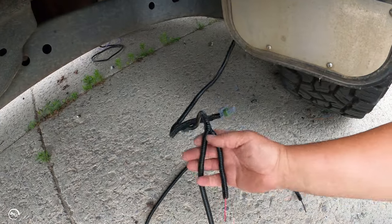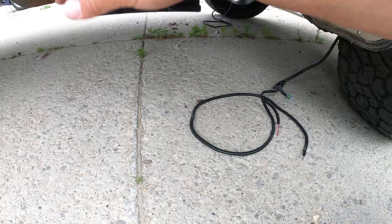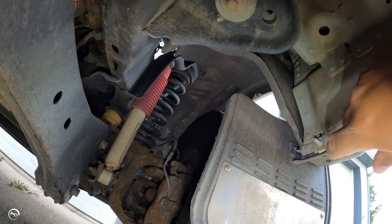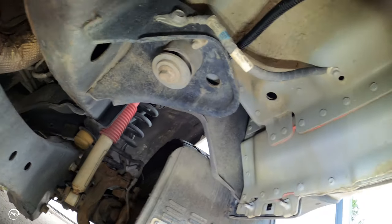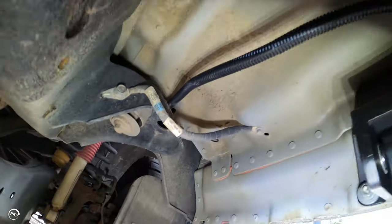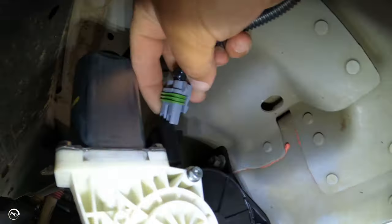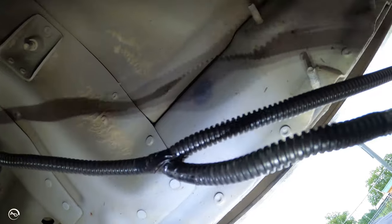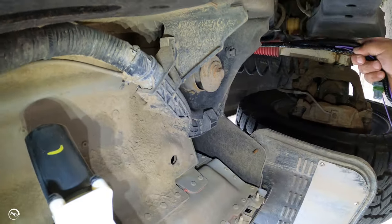Now we've got to plug in the motors. You've got two wires down here — these are for the LED lights. I slid the wires on the inside of the inner fender and up here; I slipped the body ground strap through the top, and then the motor connector connects right here. That one's connected. Then the rest of this is for the LEDs, which come a little bit later. I'm going to plug the other motor in, and then there are two trigger wires that go through the floor.